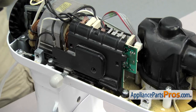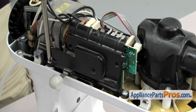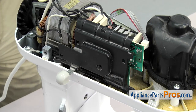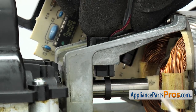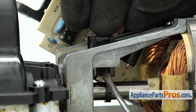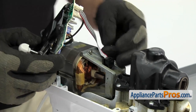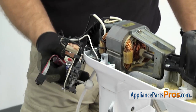With the cover off, you can use a Phillips screwdriver to take out the two screws that hold the speed control board in place. Once you have both screws out, we're going to lift the board up and out of the way. We have to use a small flathead screwdriver to release the tabs that hold the little sensor in. You just have to press on each side and get them to release. Once you have both tabs released, you can pull the sensor out of the motor and then we can swing the speed control out of the way.